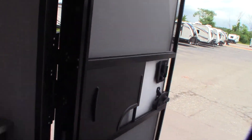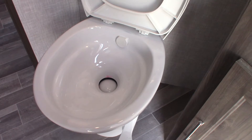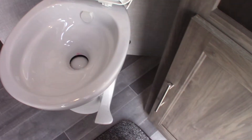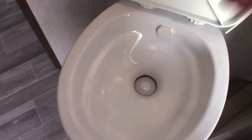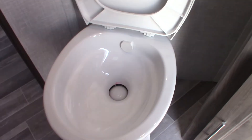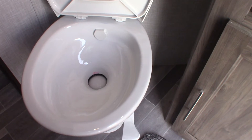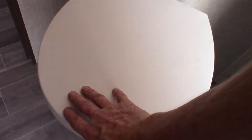The sink works the same as any other sink. What's different about this toilet compared to a household toilet is that it has a black tank directly below it, and the black tank can't be empty when you start using it — this applies to the one up front too. This is your flush pedal. What you do is hook up at the campsite — power and water — then come in with toilet chemical, dump one dose in the bowl, and step on the flush pedal. Let about a gallon of water go into the black tank along with the chemical before you start using it; otherwise the smell will be terrible and it can get clogged. Always put chemical and some water in the toilet before using it — if you don't do it, you'll only not do it once.